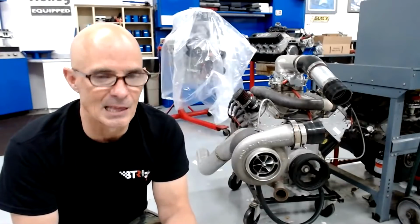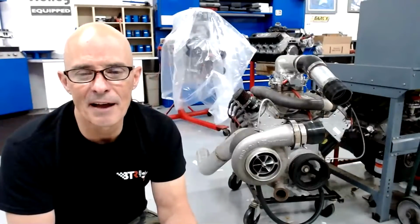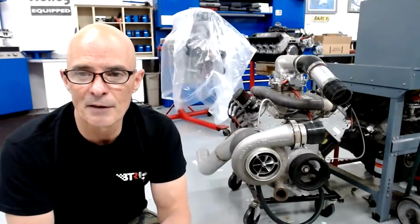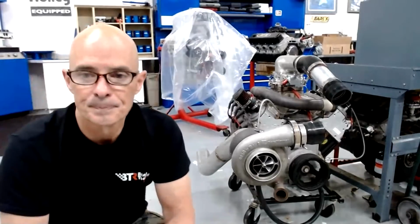Your opinions: 5.3 or 6.0 for boost applications? I'm in Florida. Mika, either one of those will take a lot of boost. I mean, we made 1,300 with the 5.3, and guys are making a lot more than that, especially on the Gen 4 stuff. That was Gen 3. So if you have a 5.3 with Gen 4 internals in it, and you put a cam in it and boost in it, you can make about a bajillion horsepower with that. A 6.0 is going to make more. It's going to be more torquey. You just have to make sure you size your turbo right for the 6.0 because it's going to have more back pressure because it's bigger.